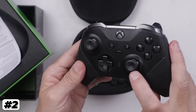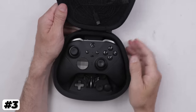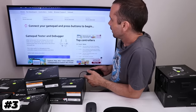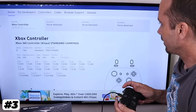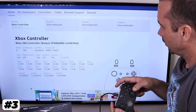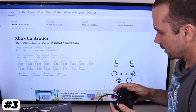The analog sticks are definitely a little bit worn, but really not too bad. This next controller came without a box, so since I don't know what's wrong with it, let's connect it up to a gamepad tester and see what shows. We got an RB button that does not press easily — I can press it and it just doesn't show up on the screen at all. If I press harder, it does register, but only harder right in the middle. So that's definitely a problem.